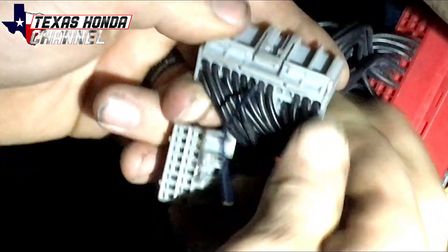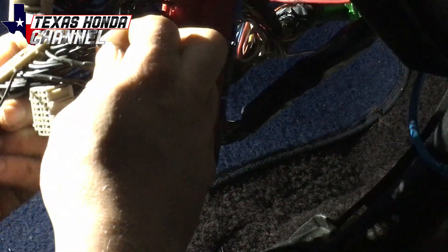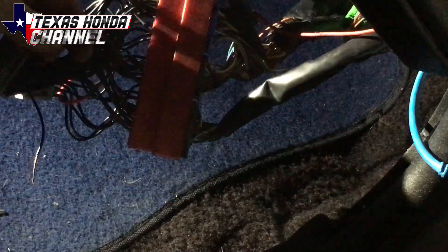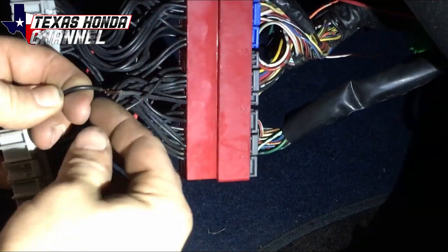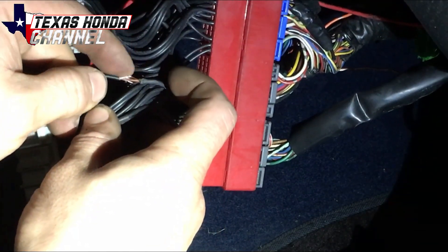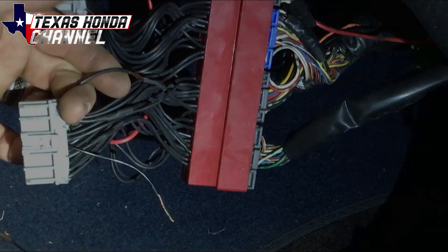Now we'll lock this back down — we've got that wire done for A11. We're going to go all the way over to the very right on the same connector at the top: A25. A25 is going to be our switched 12-volt power source, which I'm just going to tap into by splicing some wires. I basically just exposed some wires, which we'll wrap around and solder, and then our wiring will run out there.